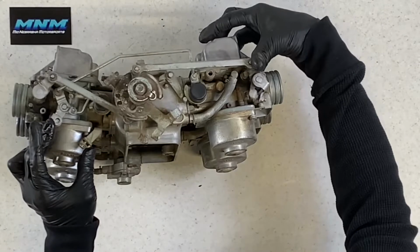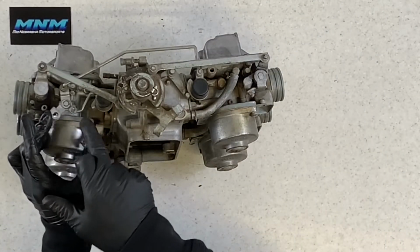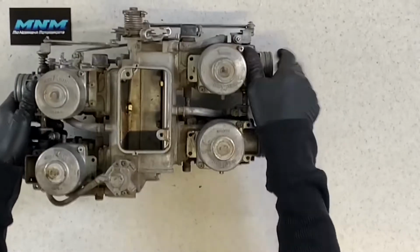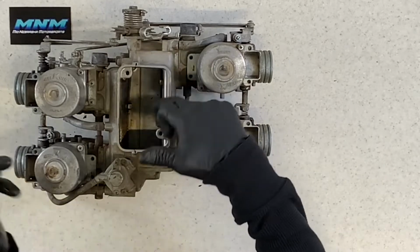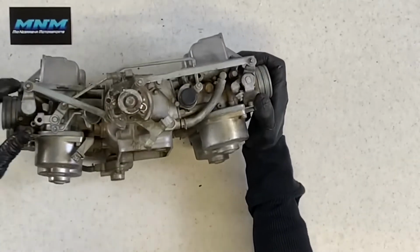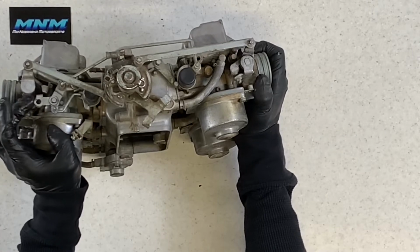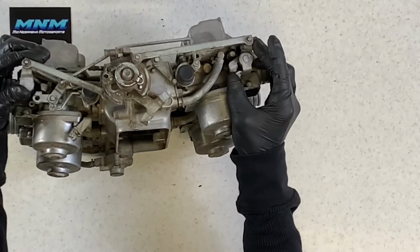If we were to take that throttle, open that up, and then move your choke arm back and forth like this, looking down into your carburetor, you're going to be able to see those butterflies open up. The other thing you can do, if you've got a backfire screen or a screen for your intake here, if you pull those, a lot of times you can see that butterfly. What you do want to make sure of, when you go to clean that, is that this snaps back properly, no issues, not being held up. And same thing with your throttle cable here.